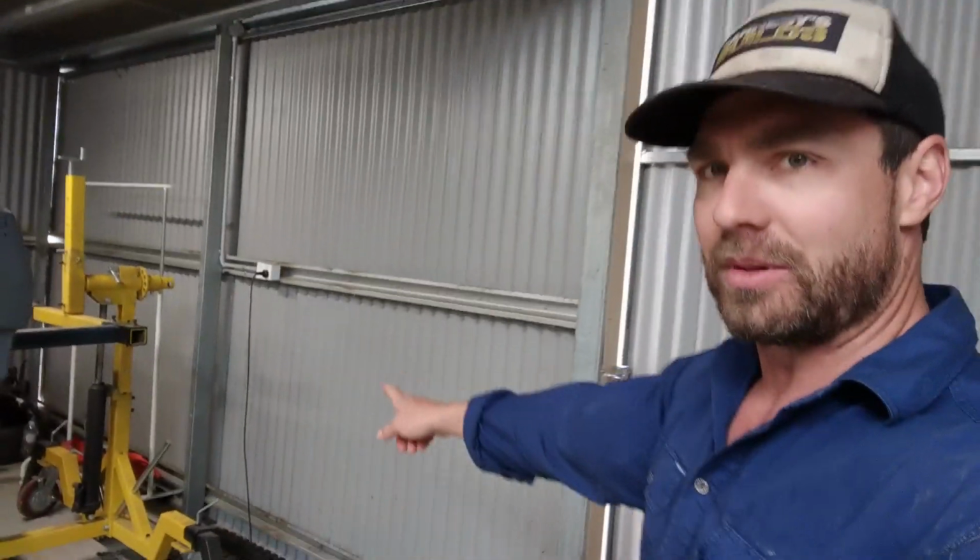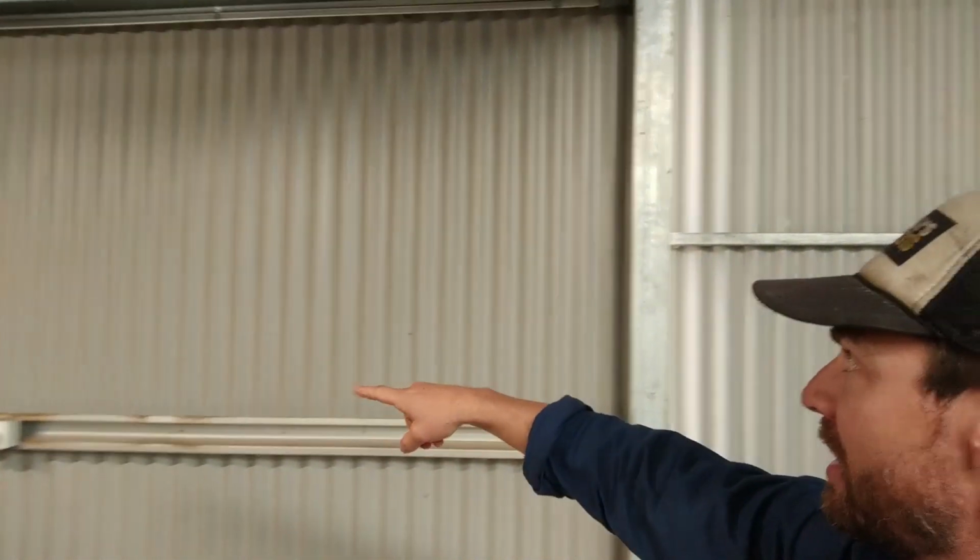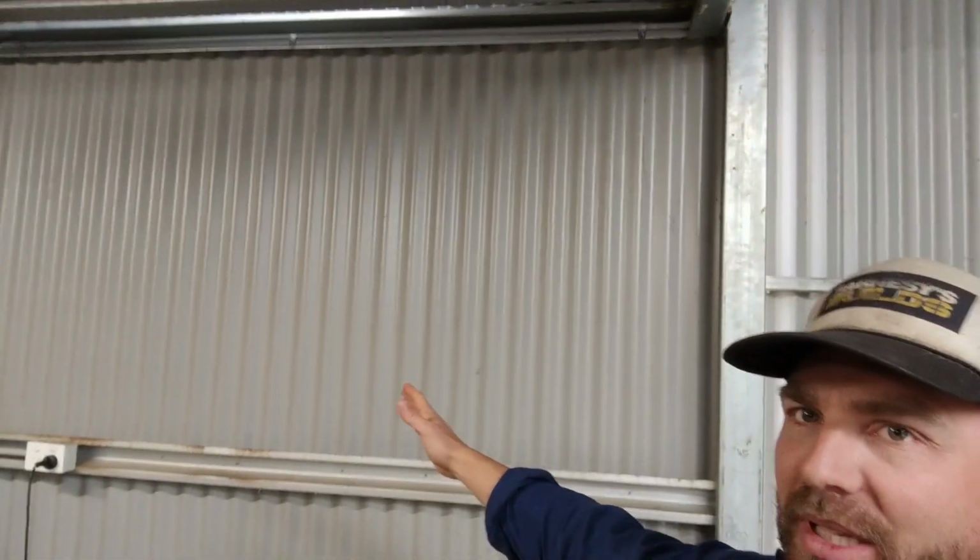Otherwise, you're looking at a commercial fan system running into about $1,000, and that would go really nicely here, probably up high. They're quite big. They can go anything from 60 centimetres in diameter to over a metre. And they're a particular spray booth fan that doesn't spark with paint fumes, and I know that when using 2-pack and stuff like that, it can be pretty dangerous if you've got exposed elements. So long term, the fan would go beautifully in there,